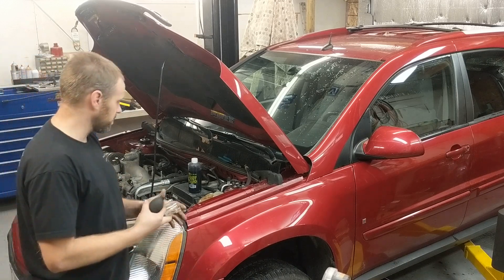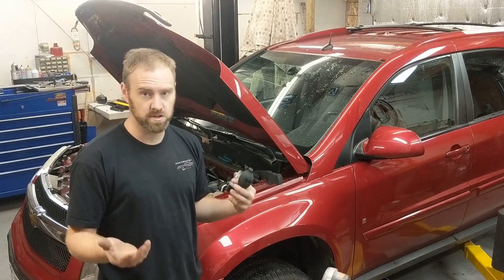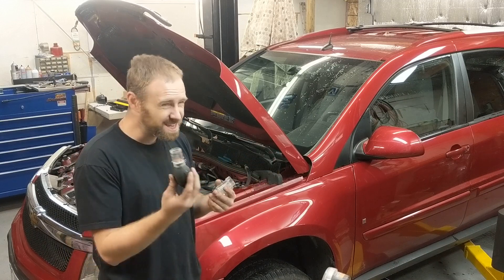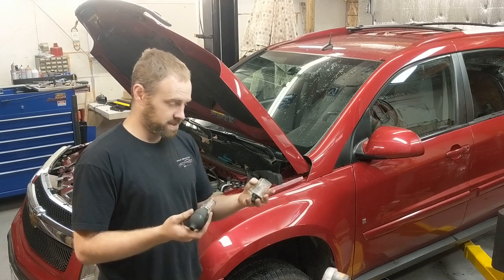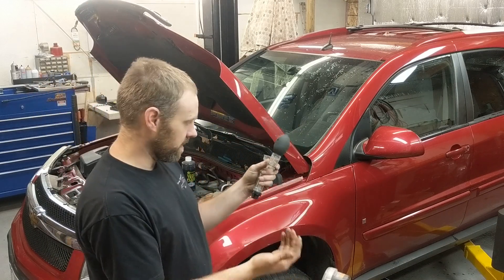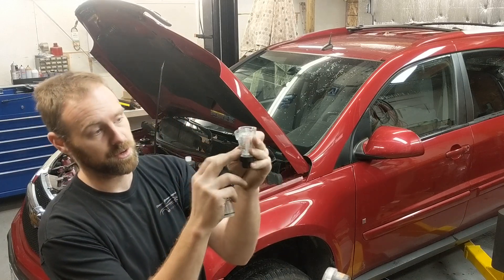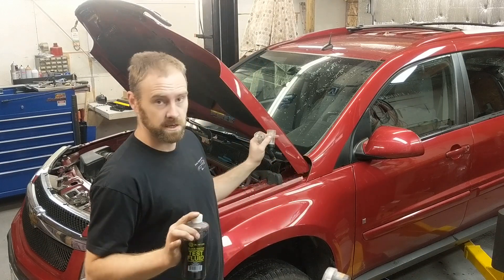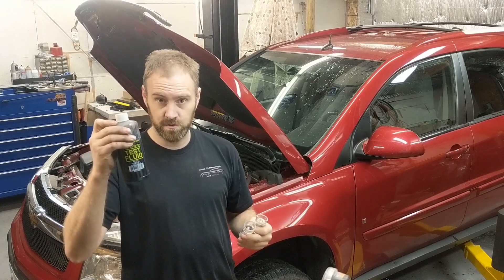It's a really simple test. You're going to need this fluid and a test kit for testing for a bad head gasket. I'll throw a link in the description below for such a test kit — they're rather cheap. This one is an old design but I feel it's the best design. I got it from an old timer who got out of the industry. It's got several chambers including an overflow chamber in case you accidentally suck antifreeze in, so you don't get it in the bulb. You fill the fluid up to the lines on the chamber. This is the test fluid — you don't want any combustion gases in the shop when you do this, as it will contaminate the fluid and ruin the entire bottle.